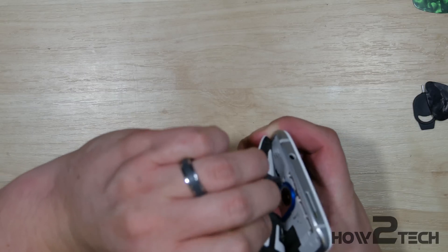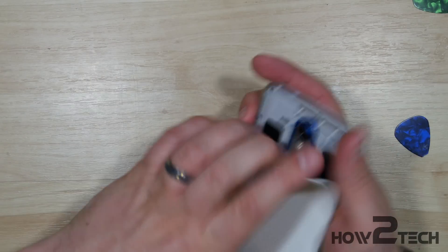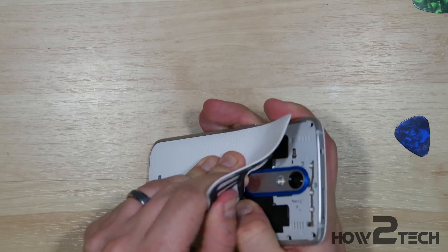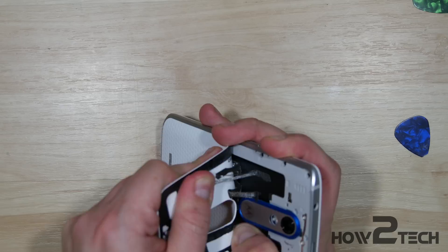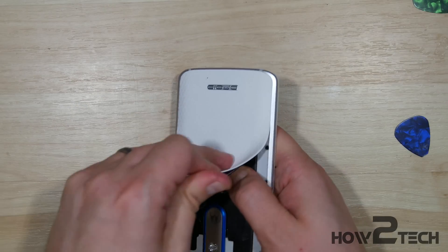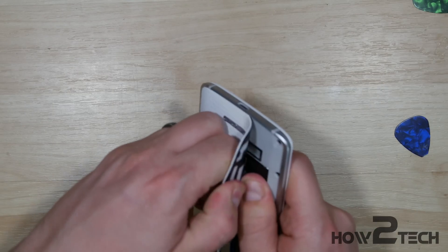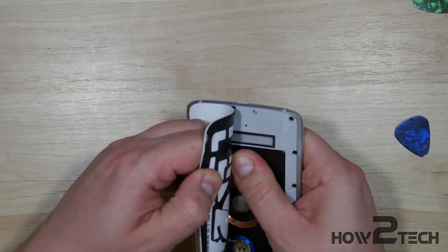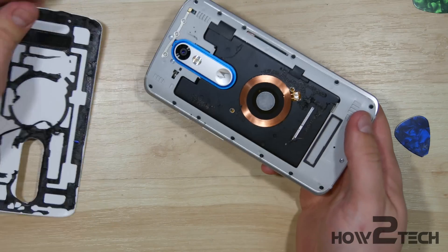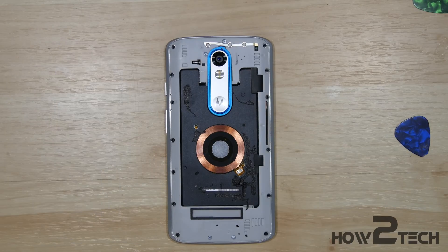Now I'm not just ripping this thing off — I'm taking my time. I'm pulling close to where the tape is to pull it back, so the back cover doesn't have any issues with ripping. So we're just going to pull it back nice and gentle, moving some of the tape if necessary as we go. There's our charge coil for wireless charging. We're going to put our thumb on it and hold it down to make sure nothing pulls up — it is just adhered to the back of this phone. There's a little piece of black plastic right here that wants to pull up, so we're going to put our thumb on it as we pull the back cover off. You can see there's a lot of adhesive on the back of this cover, so just be careful when you're removing it — you don't want to rip it or damage the phone.